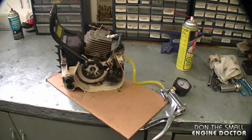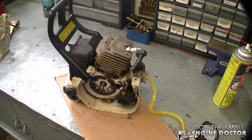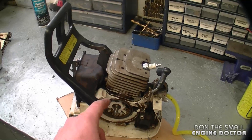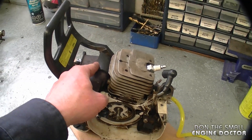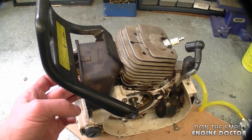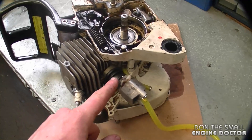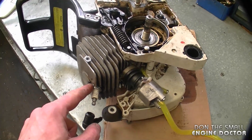So that's about it for today's test. I'm going to retest this saw when I've replaced the oil seal, just to show you guys how it should look and to find out if it has any leaks anywhere else. A few tips: when you do your leak down test, spray the soap water solution on the exhaust port where you put the rubber liner, just in case it's leaking. Sometimes you may need to retighten the muffler bolts holding the rubber liner, because you could be losing pressure there and it could be deceiving to your test. Also spray down the bellows and where it connects, and also around the spark plug.